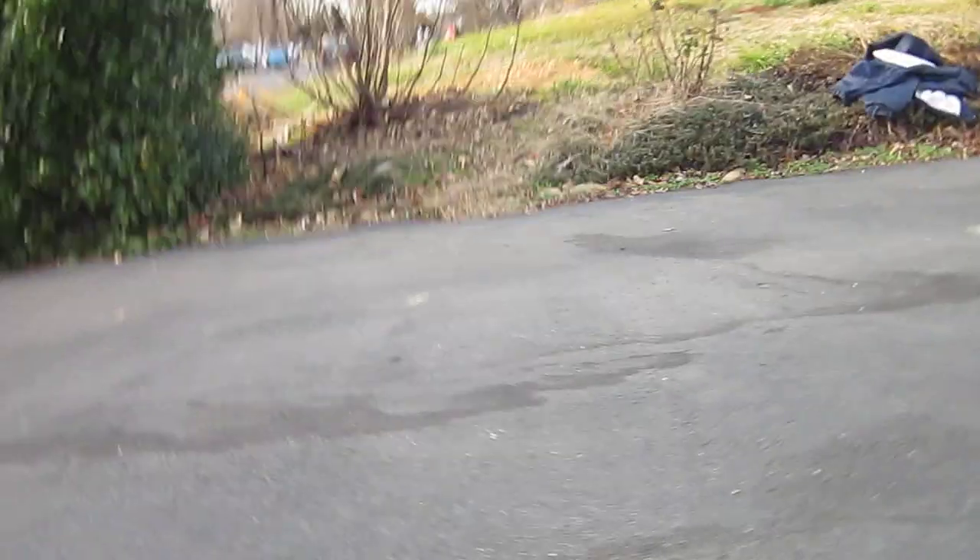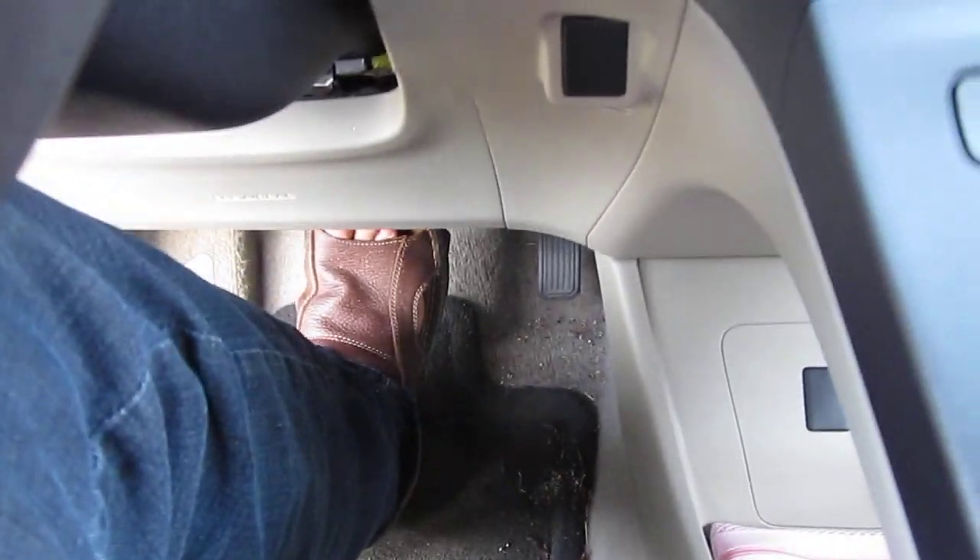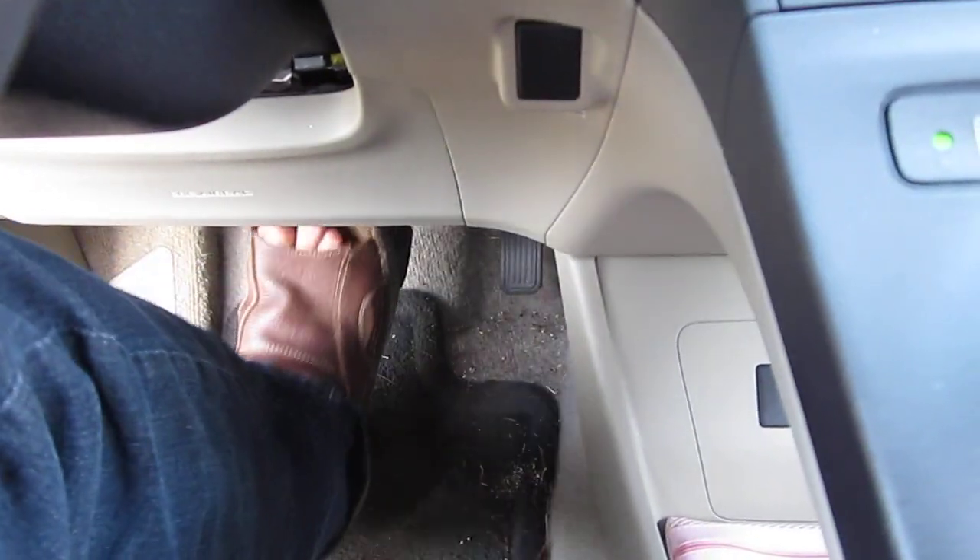The last and final step, to make sure you don't have any check engine lights or ABS codes, is to push the brake pedal eight times: one, two, three, four, five, six, seven, eight. Do it once or twice more just to make sure you have all eight.